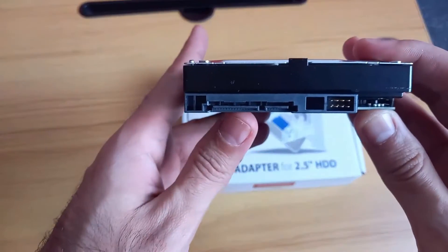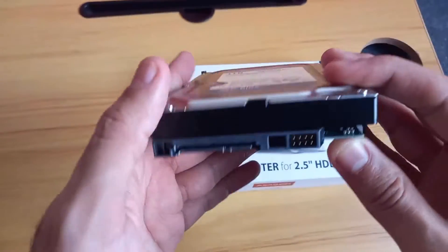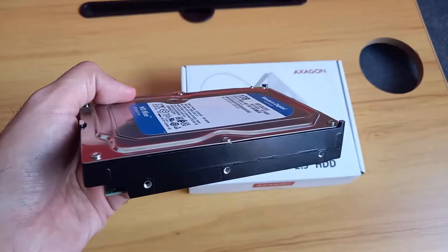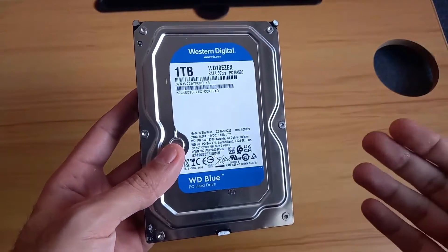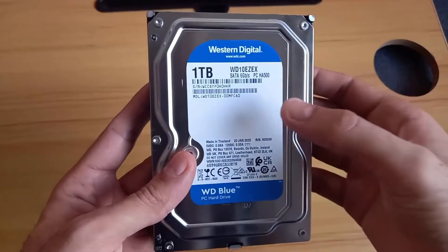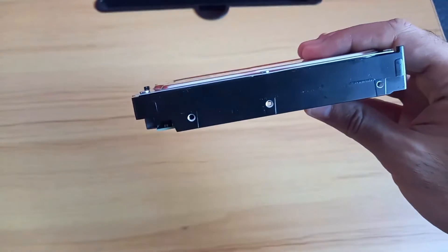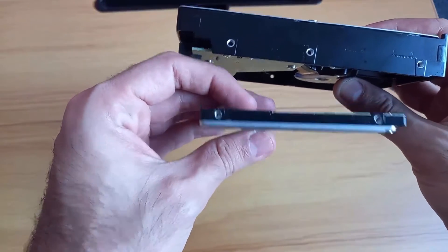The second step, we want to check the type of connector of our hard disk. As you can see, this is the SATA type. My desktop hard disk is very thick and this is 3.5 usually. If you are not sure what type of connector your hard disk is, or if it's 2.5 or 3.5, you can always Google it. However, usually on most hard disks you will find it written. On this one it's written SATA, and since it's thicker than a laptop hard disk, it should be 3.5, because the small laptop hard disk is 2.5.